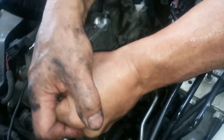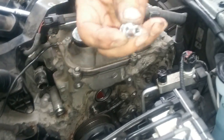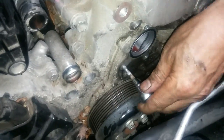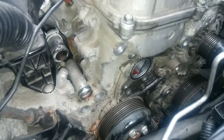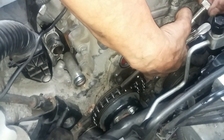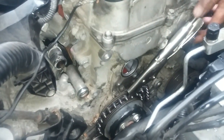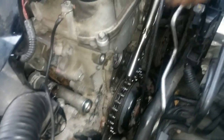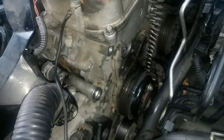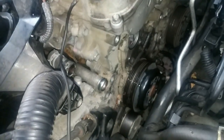The tensioner pulley bolt is reverse-threaded, so I go in the tightening direction to loosen it. I'm going to remove this stud — you have to use an E socket, so this one is an E6, attaching it to a quarter-inch ratchet wrench. Put my chain strap wrench on.